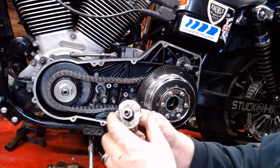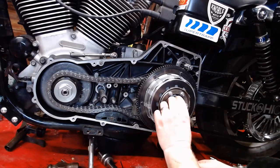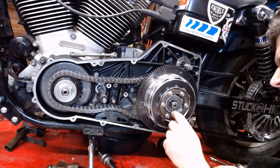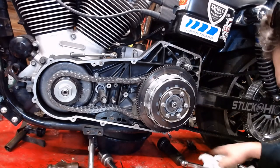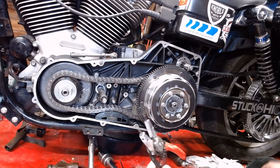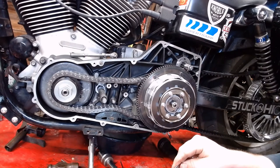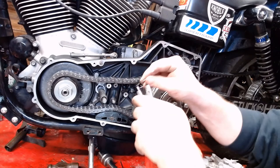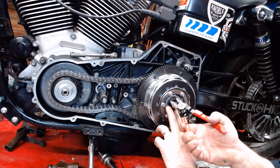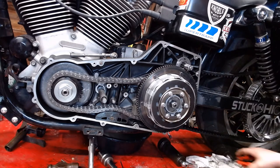This is going to be your clutch adjustment. Maybe back this in or out a little bit. Probably back the rod out some. Alright, when you slide it back in there, it'll drop in there nice and easy. And it'll be easy to get the snap ring in there. For that, snap ring pliers. It's always good to have good ones of these. Cheap ones suck. Spend money on good snap ring pliers. You'll be happy you did. That way, snap right back in there like that.